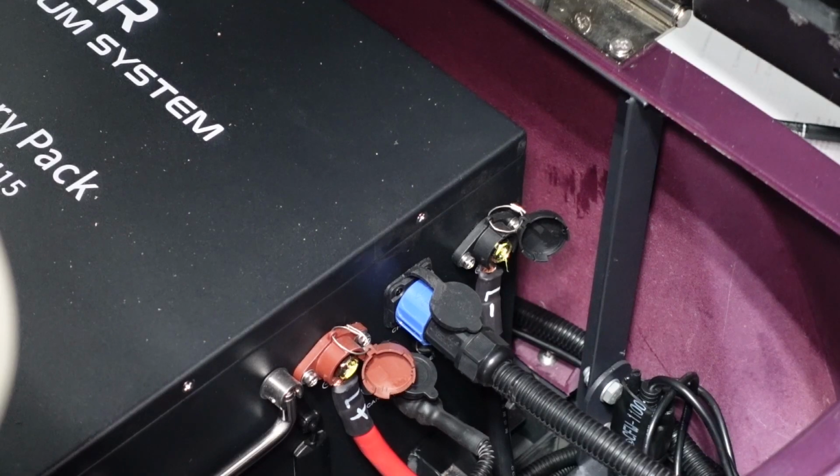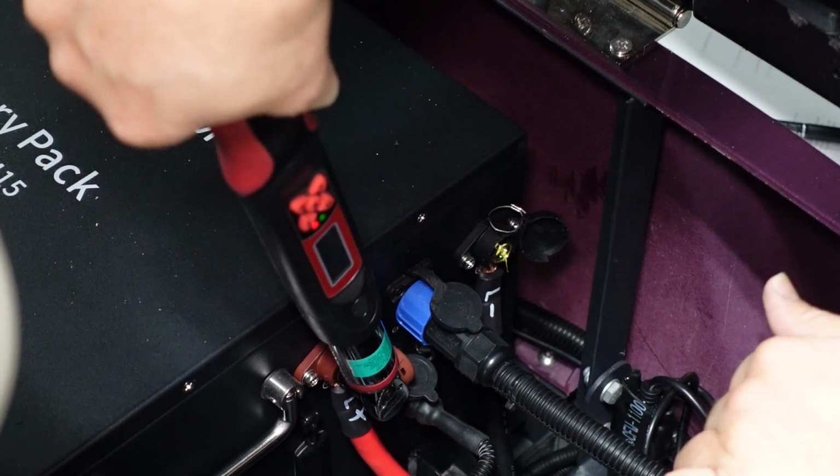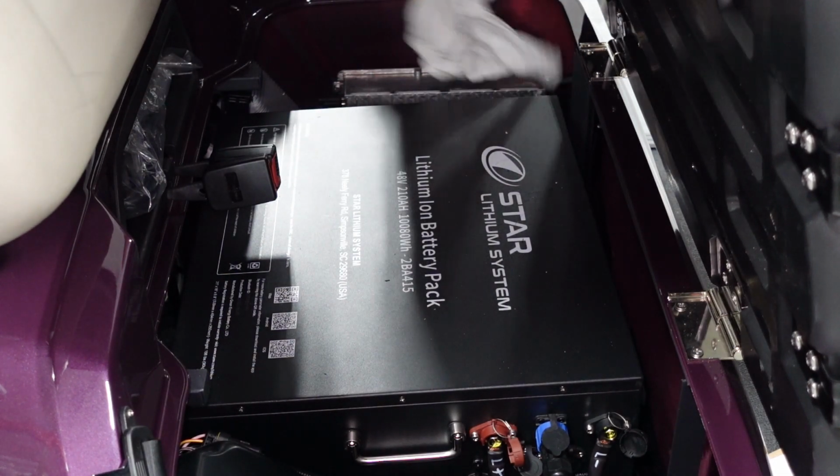For extraordinary climate maintenance, the only thing that's needed is to check the main battery terminal torque with a torque wrench and make sure that it is set to 105 inch-pounds. You will check this torque at 150, 900, 1800, 2700, and 3600 miles. That's all that's needed. You just check your torque on your battery main terminals and verify that it's tight, as needed. As far as cleaning, all that's needed is to wipe the battery down with a clean, dry cloth.